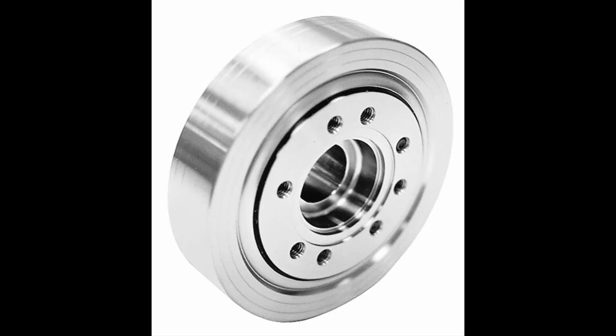If you think about it, the crankshaft is rotating this way, which is your rotational energy, so it's got to be balanced this way to prevent vibration. While this is rotating this way, the pistons are going this way, which is the reciprocating weight. So when you're choosing your crankshaft, you want to see, is it balanced? If it's not, you're going to have to take it somewhere and have it balanced, unless you want to purchase a vibration damper or a torsional rotational balancer that's going to take care of the vibration of an unbalanced crankshaft.